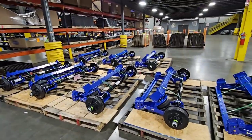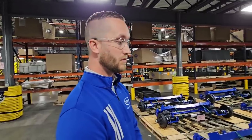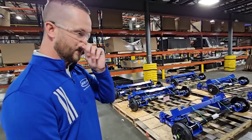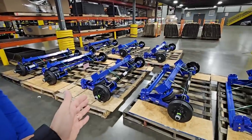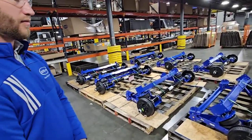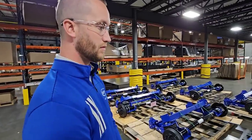Where I could see this is on the cargo trailer side or the car hauler side, mainly to drop it down so you can load things in like sports cars, and then raise it back up for traveling. Especially because almost all the suspension you see on cargo trailers is traditional leaf sprung suspension with a standard equalizer, but this could cushion the ride while at the same time giving you the flexibility of raising and lowering the approach angle, so you can get vehicles, tractors, mowers, and all sorts of stuff onto your trailers more effectively.